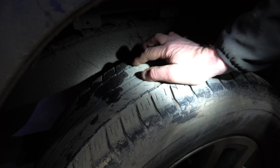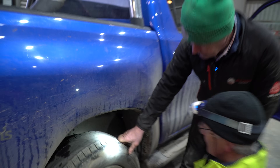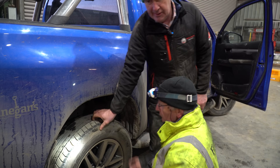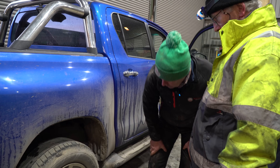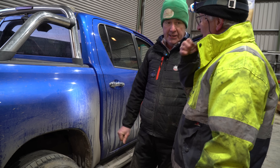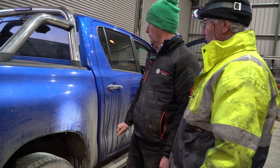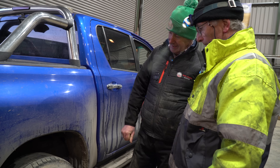That tire pressure is a bit on the hard side — it's ballooned the tire up. Bad air can do it too. You'll also find with wider tires, especially on BMWs, the inside will be more worn. You can be putting your hand on it thinking the tire's not bad and then all of a sudden it's completely gone inside. So check shocks and the exhaust — basically get underneath it on the dolly and have a look, or if you have a pit. Check brake pipes as well. This is a fresh one so you shouldn't have a corrosion issue.